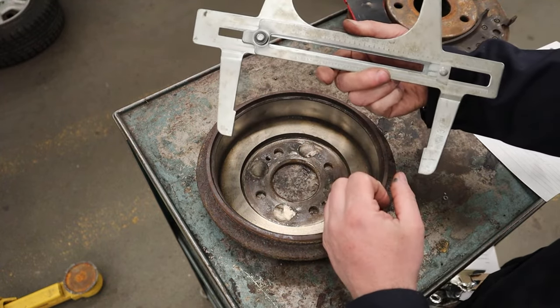For the drums themselves, there's still a millimeter of material left, and steel drums wear more slowly than brake shoes, so there's plenty of life there too. Before putting the drum back on, take a wire brush and clean the centering hub area to remove dirt and rust, then apply a very thin coat of anti-seize so it comes apart easily next time. Special note: do not put anti-seize on your wheel studs — lug nuts are torqued to a dry spec. If you got greasy fingerprints inside the drum, use brake cleaner with safety glasses on to clean it.